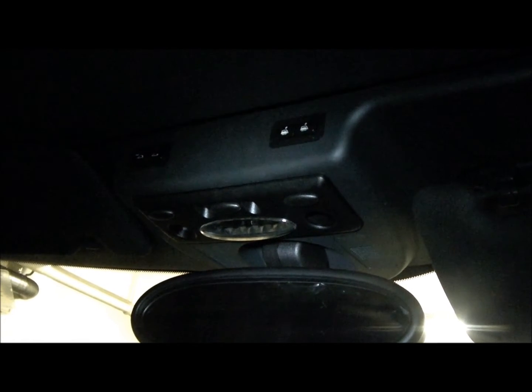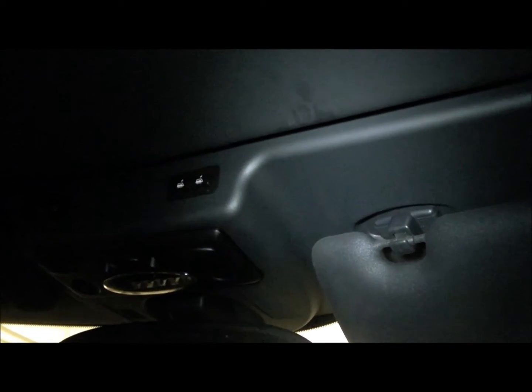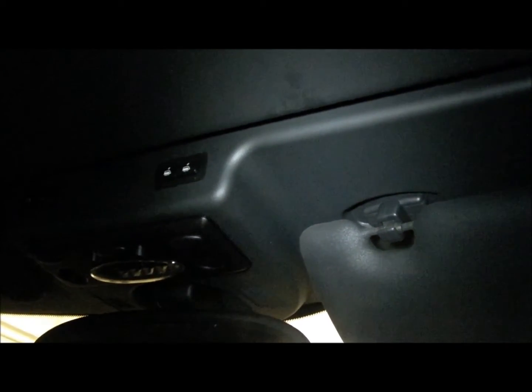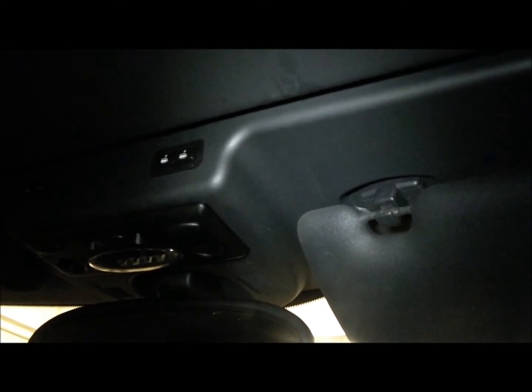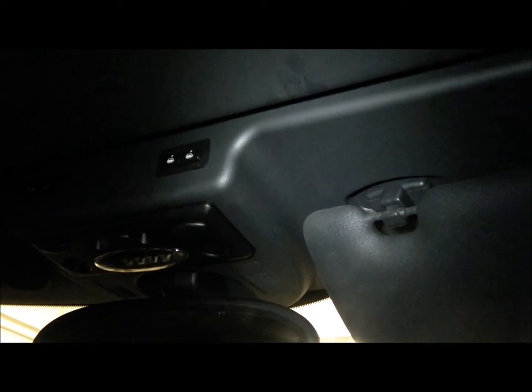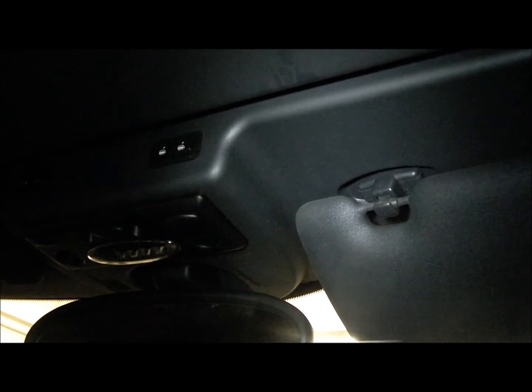Once that's popped down, you unplug it, and if you look straight up, you will see the nut that actually holds the air rail on. If you undo that nut, the air rail will pop out, and then behind there, located underneath there, you'll find a plastic molded cable holder that the cables clip into.